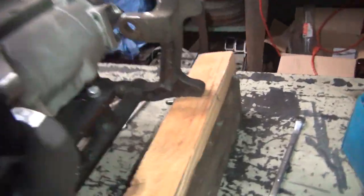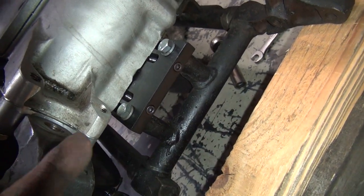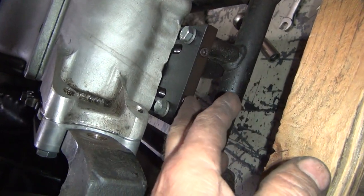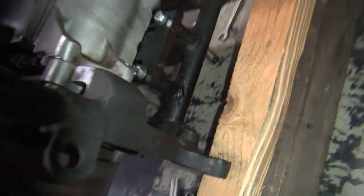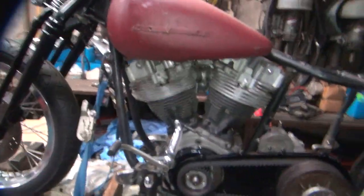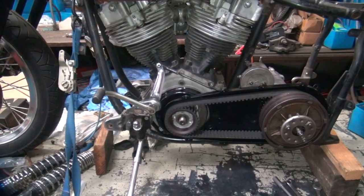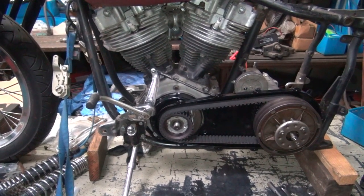So tranny plate does work. I'm just pulling these bolts back right here a little bit at a time, then we go ahead and tighten those down. Now these might vibrate out of here, because there's nothing really retaining those — I'm just unscrewing and coming out. So they might actually vibrate and disappear if you don't have some kind of retention device on them. They probably will disappear. Harleys do shake — that they do.